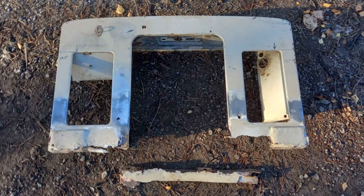And here it is in all of its glory. Now, anybody who's had an old Land Rover has most likely seen this. Bottom of the panel completely rusted out. And now the reason they do that is because along the bottom edge on that return, they've actually got another piece of steel in there. It's a double layer. Now, water gets between that, rust starts, and it blows the panel out. They all did it, so it's not a big deal.